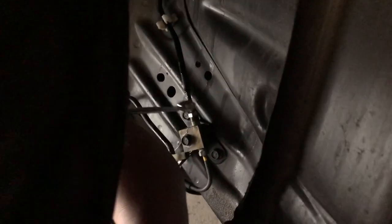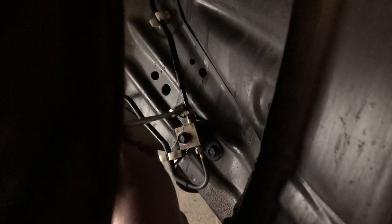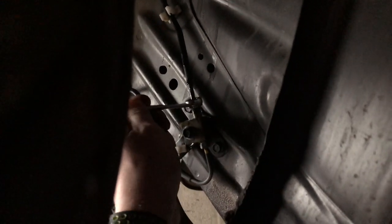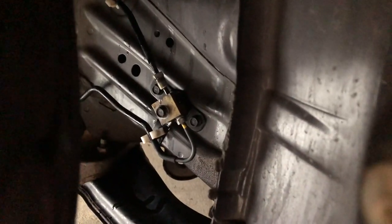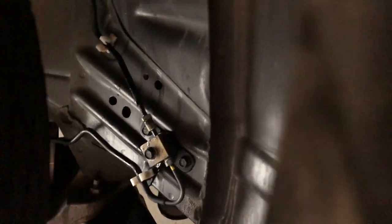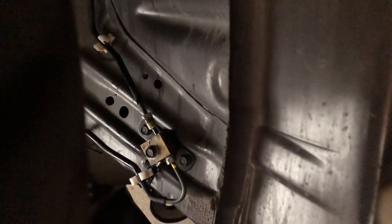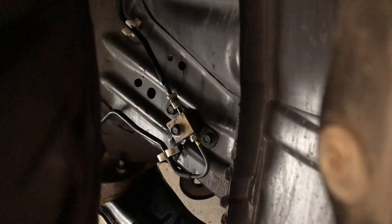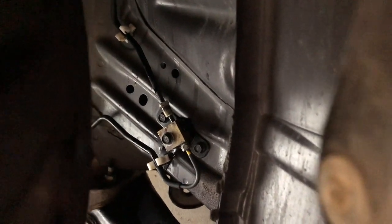I've been able to get the line-end wrench in there and as you can see I'm able to turn this — it's not stuck at all and came out right away super easily. You will notice that fluid is leaking out. Obviously if you were not having a breakdown and wanted to change this line, you would absolutely want to bleed the entire system before you did this because I am just leaking brake fluid, which is super bad. According to the service manual, if you get brake fluid on any paint, wash it off with water immediately. I've been bringing a bucket of water out and dumping it on anything that gets brake fluid on it. Anyway, that connector is now free.